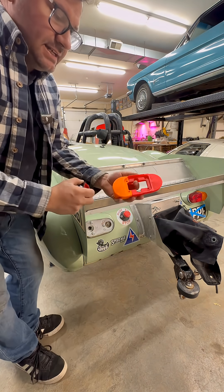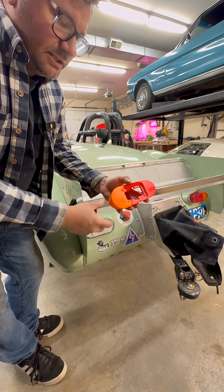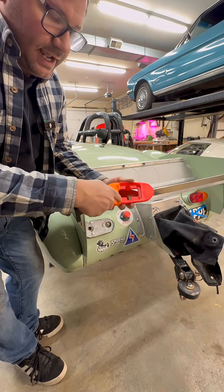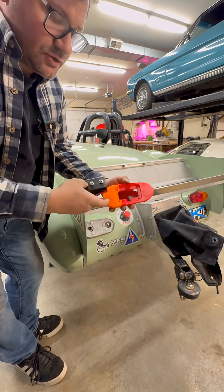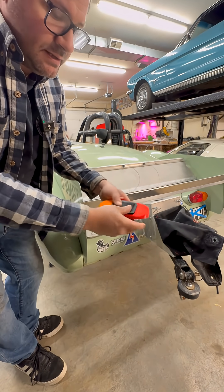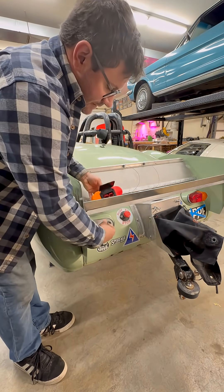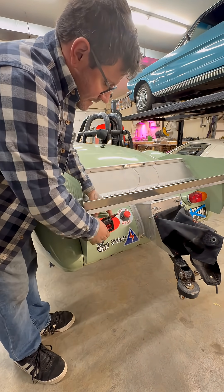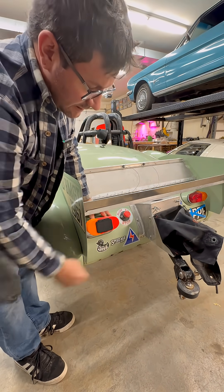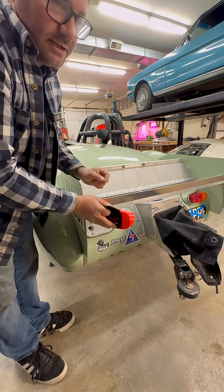So what I did is I had a friend help me design this lens, just because it was a little more complicated than what I'm capable of doing in Fusion. Then I went ahead and made a pocket and extruded that down for our plug, and that snaps in. I'm going to print this trim ring, which will actually get recessed into the tail light, so it still looks like a factory tail light but it'll be our charger lug. The other tail light will still work.